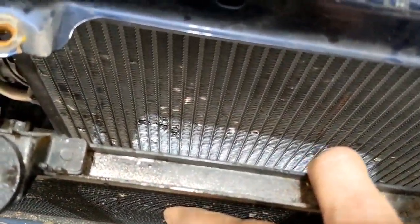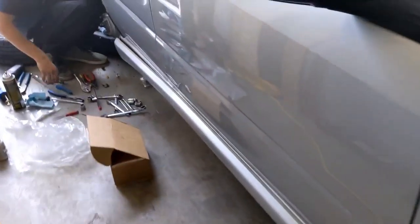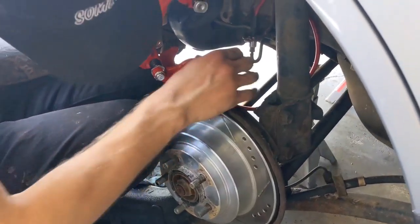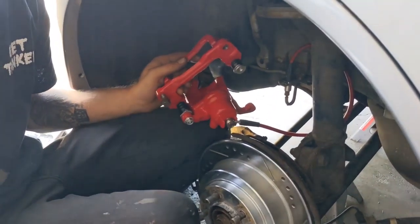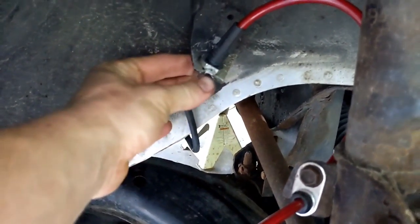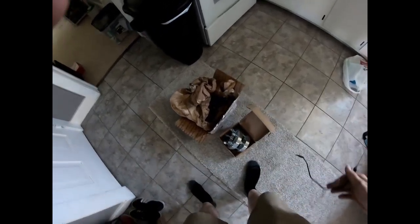She's excited to drive her car again. Everything's back on - I had to get some hose clamps for the trans cooler lines at the bottom because the original ones were kind of janky. I put a few dents in the fins near a bolt that sticks out of the condenser, but as long as it didn't hit the cooling passageways it should be fine. Now I just gotta let this thing warm up and burp it. Matt's finishing up his brakes, just lubing up the last one. How would you rate doing brakes here? 'A lot better than at home.' Everything can go smoothly and then you get one of those brake clips and it'll just ruin your entire life.